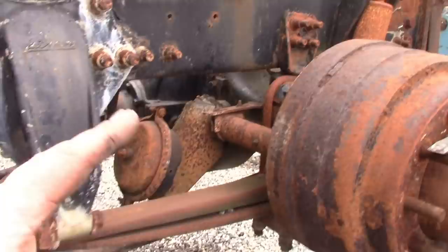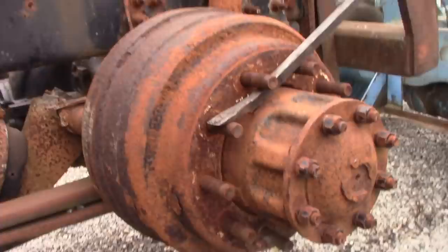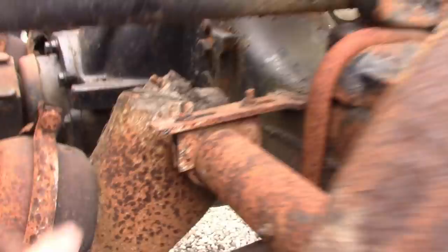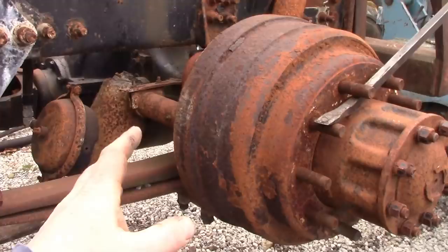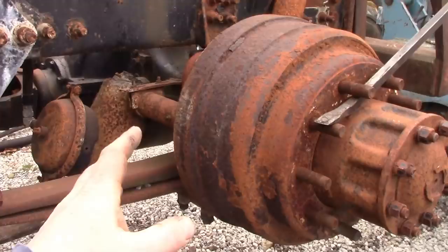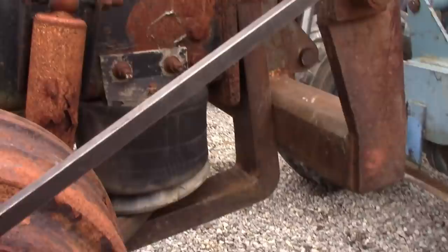We're going to lift this up — this is the suspension and the rear axle I'm going to use for the F750 we're working on right now. It's an air ride — it's an Airliner. The tag is missing off of the rear axle, so I went to the front, found the plate down here, and it matches — we got the right ratio. It's at least a 20,000-pound axle. Being it was a rear drive axle, this particular one doesn't have a parking brake on it, so we'll have to change these brake chambers out. We're putting a 30-30 on it instead.